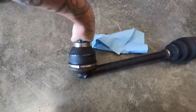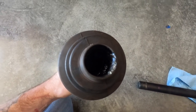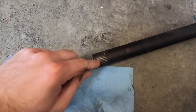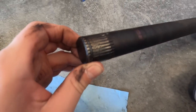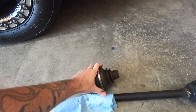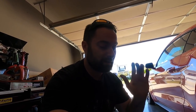Look at this — it is completely broken. We can't cut the boot because that would not allow us to exercise our warranty, but that is what she looks like — completely snapped in there. Look right there — the ridges are really kind of flattened out. That's nasty. This is a warranty item. These are Level 6 axles, and before you guys tear up DSS in the comments — this is not a sponsored video by DSS, I do not have DSS as a sponsor. I can say whatever I want about them, but I want to honestly say that I think this is not a DSS problem — this is a bushing problem, something that we have not done yet.